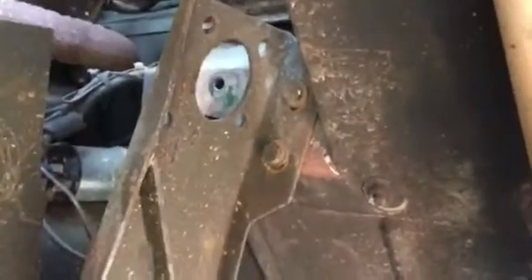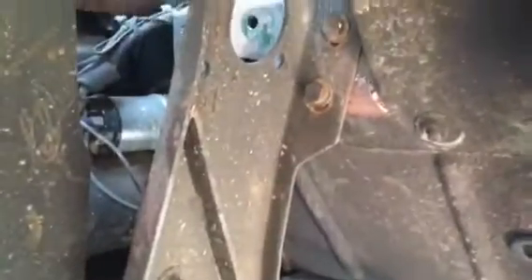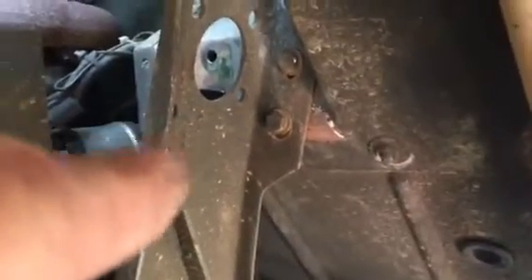What's going to end up happening is when this truck does have its restoration modification done and we bring in the TDI, at that time we'll throw in a spot weld here, tack this up with a bead of weld on either side to make that nice and structurally strong again. And at the same time, with my splash guard, I might be able to fabricate a little bit cleaner cut, and with my footwell I might be able to be even cleaner than I am right now.